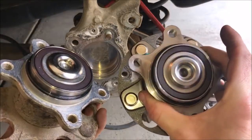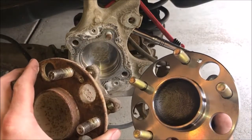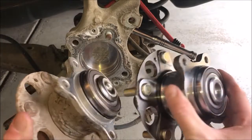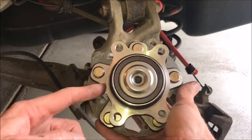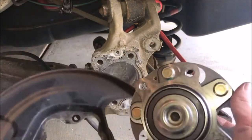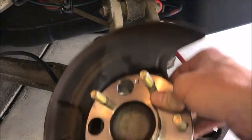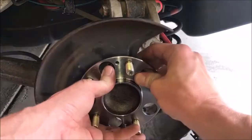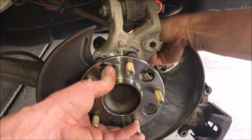Here's a side-by-side comparison of the old and new wheel bearing assemblies. The old one has 260,000 miles on it and very much needed to be replaced. When installing the new wheel bearing, make sure to match up the proper sides — there's a flat edge and a curved edge, I show the flat edge here. Also, don't forget to install the shield at this point if you chose to remove it. Now install the four bolts that secure the wheel bearing assembly and tighten those to 42 foot-pounds.